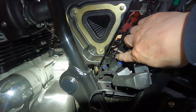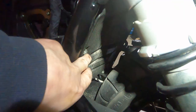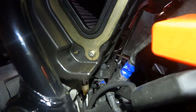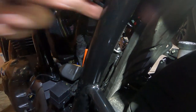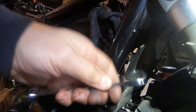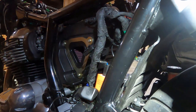This came out pretty easy — pulled that little plastic bolt and just popped it out. Turns out there's another bolt here holding in the battery box. I see I missed another little piece of plastic there, a little screw thing I've got to pop down through that metal piece. There is one more bolt right here — you can't really see it from the other side because it's just behind this flap. That last screw behind the flap was pretty hard to get out; I had to take out another screw to pull the flap back and come in through the other side with a wrench. It's out now.